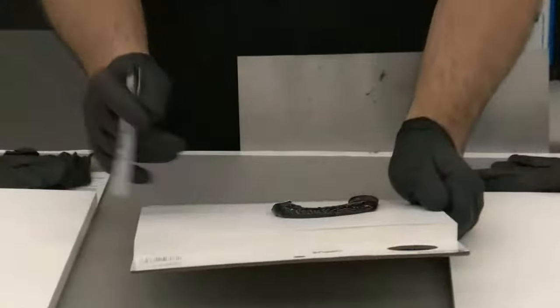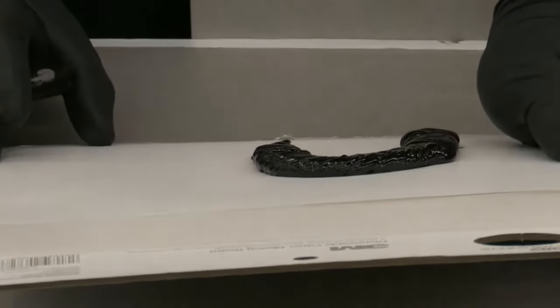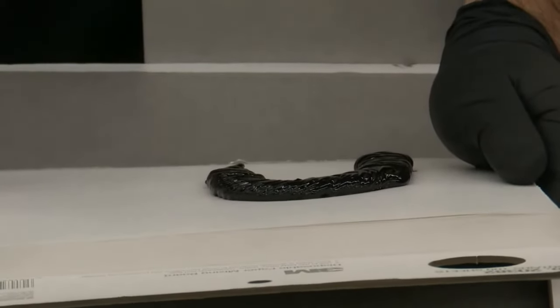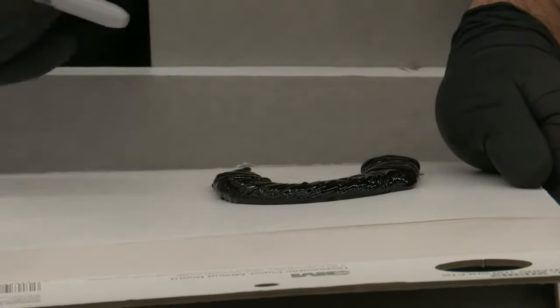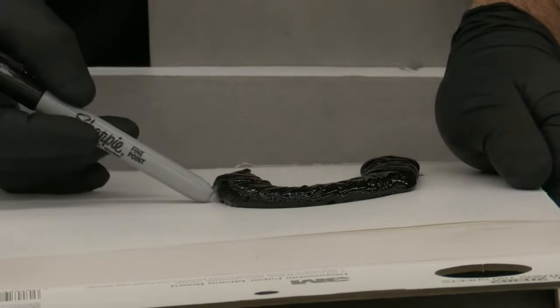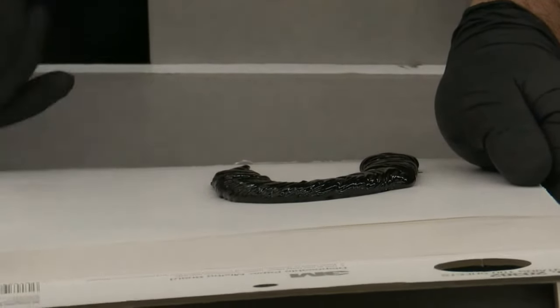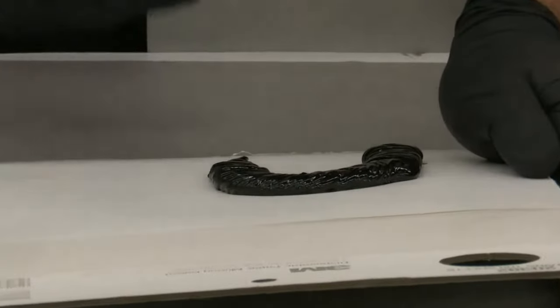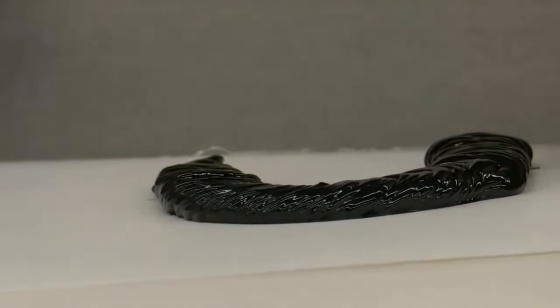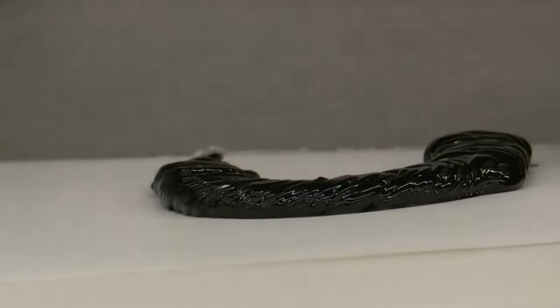I've got a pretty high lofty bead. In a lot of cases, we've got very thick, very dense seam sealer applications on vehicles. Toyota is infamous for this. Hyundais, they have a lot of this stuff too. And you can see along this edge here, there's the possibility that if I don't get my paint gun all the way around there, I'm not going to have appropriate coverage on that surface, right? I'm not going to have all that bare metal covered.